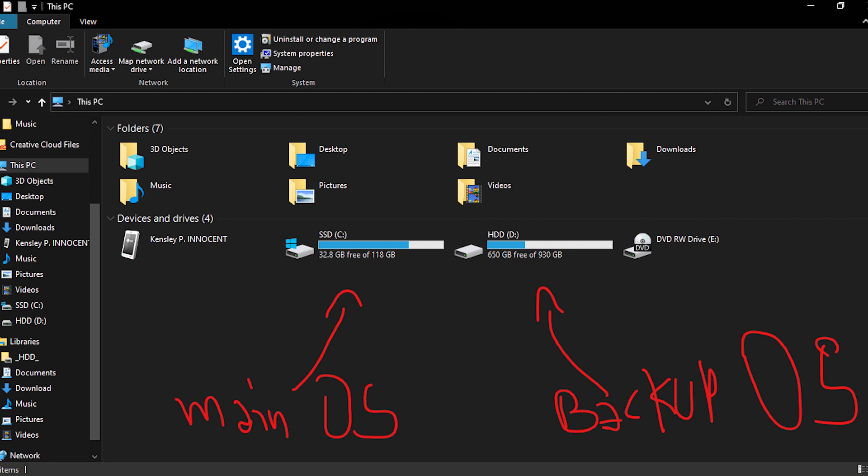Fourth, I suggest you have a second computer, or one with two drives with two versions of Windows. As an example, mine has a 128GB SSD and a 1TB HDD, both with Windows installed for different purposes. Sometimes fastboot won't properly work, so a backup computer is generally a good idea. Also, make sure that your USB cable is fine. Some reported that a USB 2.0 port is sometimes beneficial.